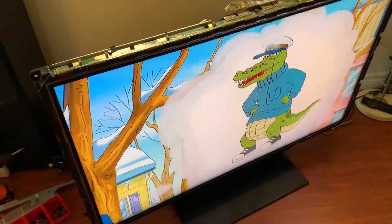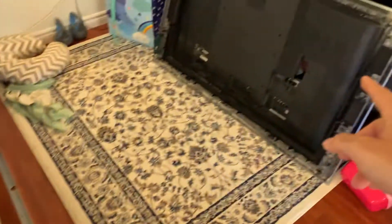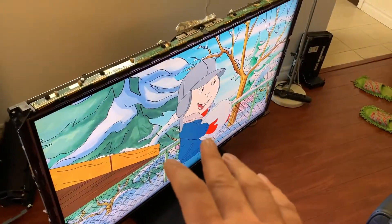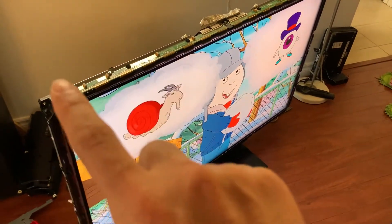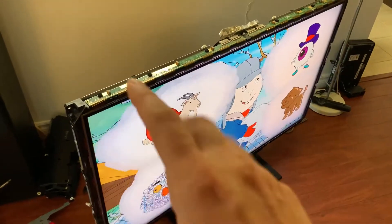All I've done is I've taken off the back of the TV. The back is right there. I don't have to disassemble the stand — it remains standing. This TV is very heavy, around 100 pounds, but it can remain standing and we can remove the back first, and then the front bezel can be removed by opening up the screws. The screws are right there.